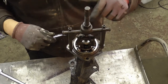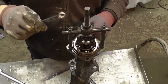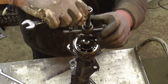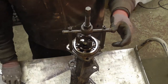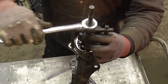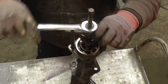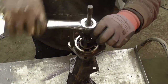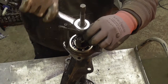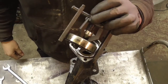Once you've got your tube off and you want to get your bearing out, it's good to turn it over and put a bit of bar down and try and tap it out from the inside edge. But if you've got a basic puller like this, they're less than a tenner on eBay, and they're really simple to use. So it's not worth messing. Just get yourself one. This makes everything so much easier. So I'll try and pop a link in the description. One of the best tenners I ever spent.